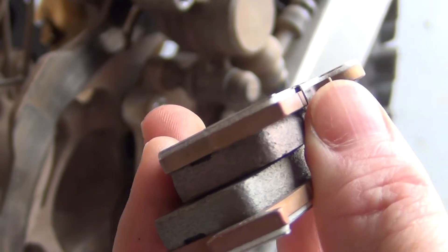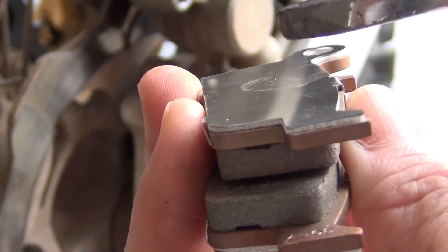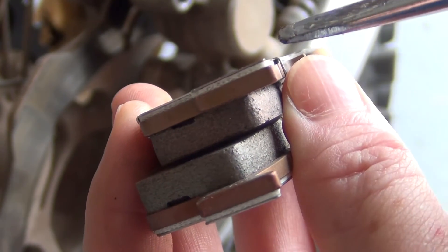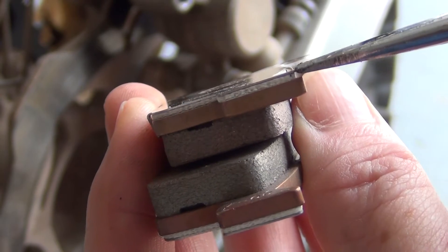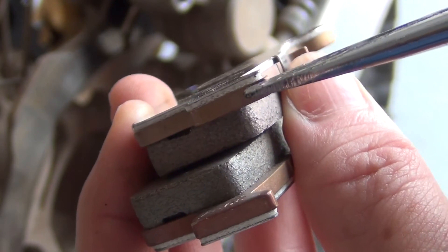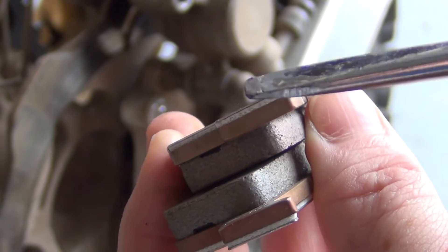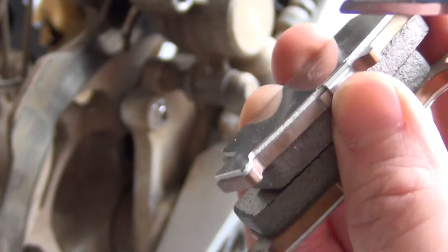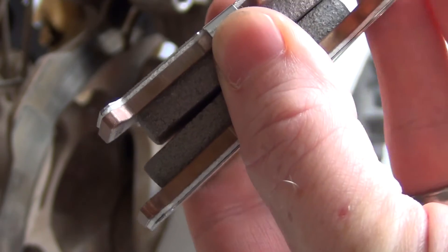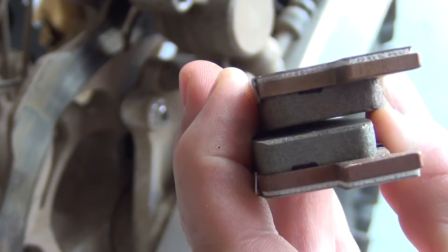But notice the difference in the construction — zoom in here if I can. Now let's check out the layers. Get my screwdriver here to point. So you got this metal top coat or plate, which I would guess is so it doesn't squeal, and then you got this — I think it's a ceramic layer. Now what that's going to do is not transfer heat from the pad to your caliper. So yeah, these cost a lot more than $5 pads, but you're not going to boil over either. Quality made — you can see how much material they give you.